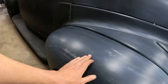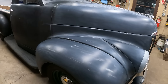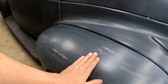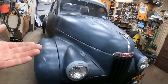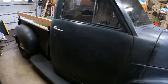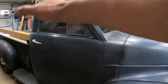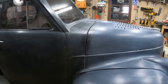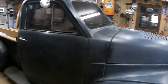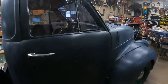All this paint had — what is all the dents on top of this fender? What in the world? It's like something went like that on top of it. Anyways, these fenders are body-worked all the way. We're just painting her black real fast. It ain't going to be perfect. The cab is already black — the whole thing is going to be one color, so we're just going to fog it right on. I'm going to plastic off the back half of the truck, plastic off under the hood. I'm going to wipe it off one more time to get any residual dust off. I'm going to turn the temperature up just a little bit to get the temperature of the truck up, and then we're going to get out the turbo cans and shoot it!